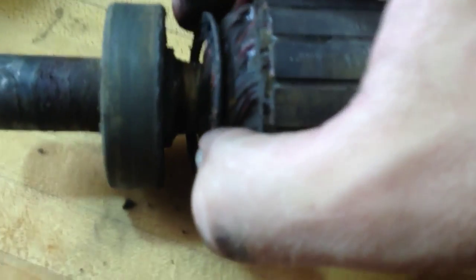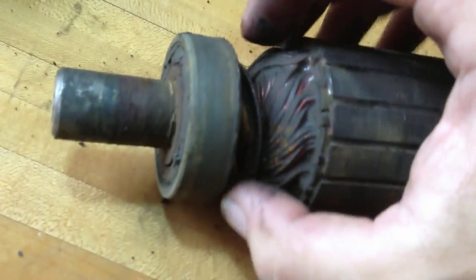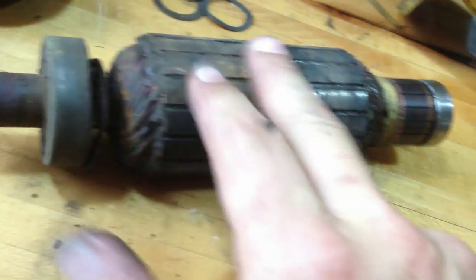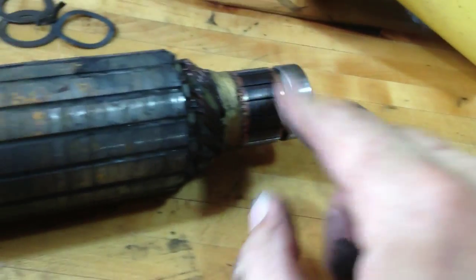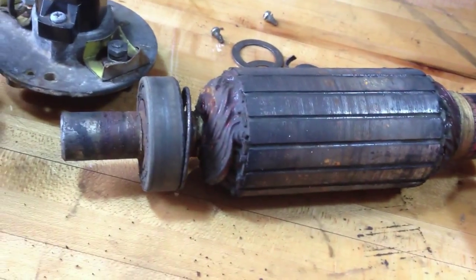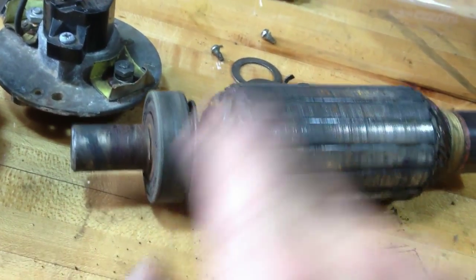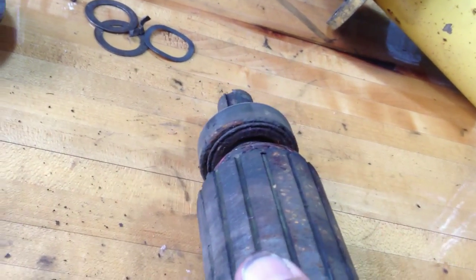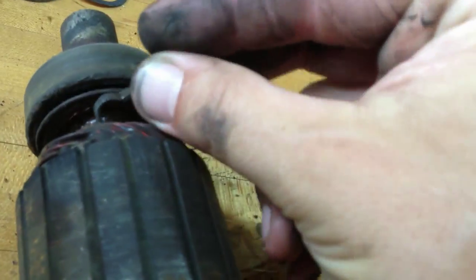It's got a little rusty cover. So I'm going to have to pull this bearing off, replace it, clean up the shaft, clean this all up, maybe polish up the commutator. That right there is obviously the reason why this was not spinning freely. Next step: replace that bearing. I don't have that bearing in front of me, so you'll have to wait until next time.